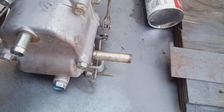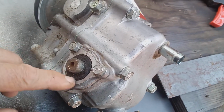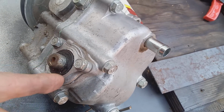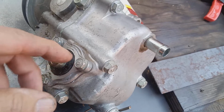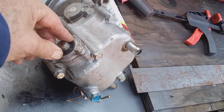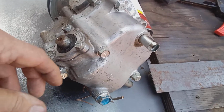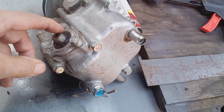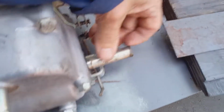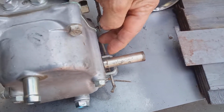Now, the worst case would be that the seal is damaged. You push it back in, and then you work the machine, and then it leaks oil anyways because the seal is cracked or dried or whatever. Then the seal has to be replaced, which is a pretty major operation actually. You're gonna take the side of the engine bed off. It's a pain in the neck. It's a $6 seal, but most of the time the seal can be pushed back in and secured with a hose clamp or some kind of clamp so it won't push back out. And most of the time that works.